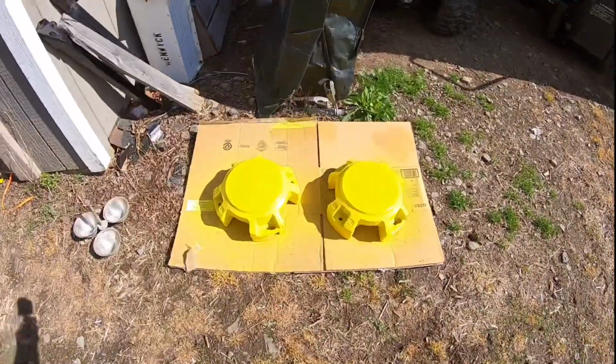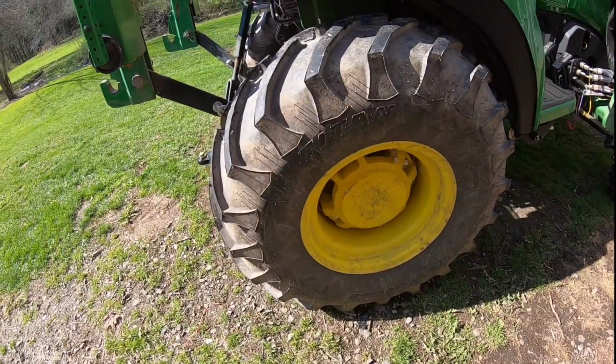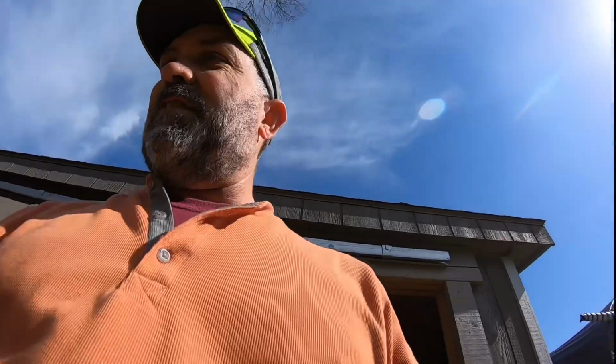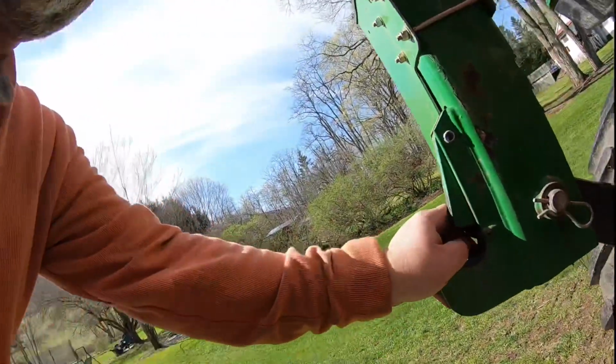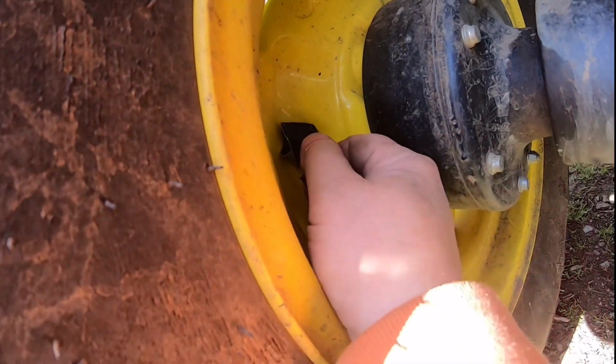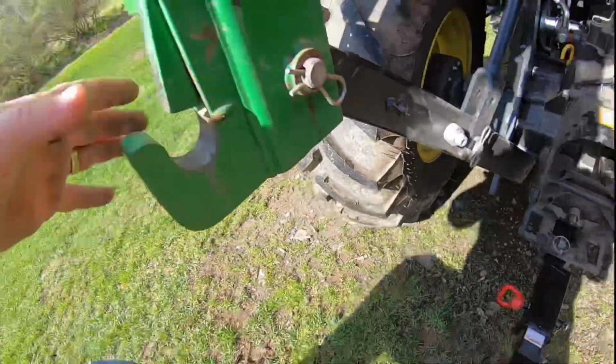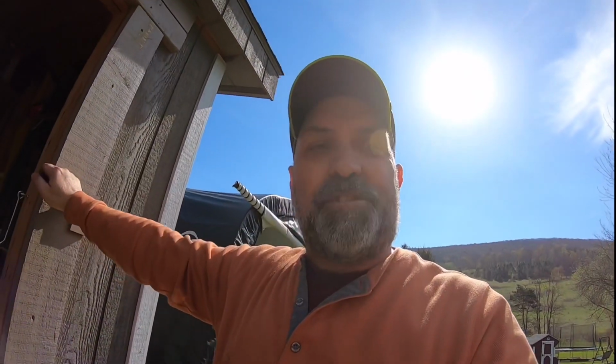So here's a couple of wheel weights. I got 2 on it, got the insides on it, and I'm gonna show you Pat's little tech tip of the day, because the inside bolts are carriage bolts. What I did to hold them, because I was by myself, is I taped them to the back side of the wheel so that when you slide the wheel on, the bolt stays somewhat where it's supposed to. I mean, it wasn't perfect, but doing it by myself, it actually worked quite well.